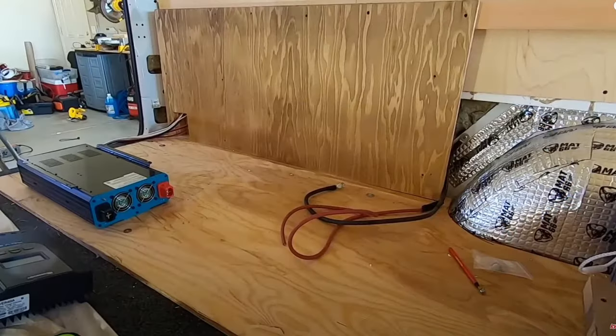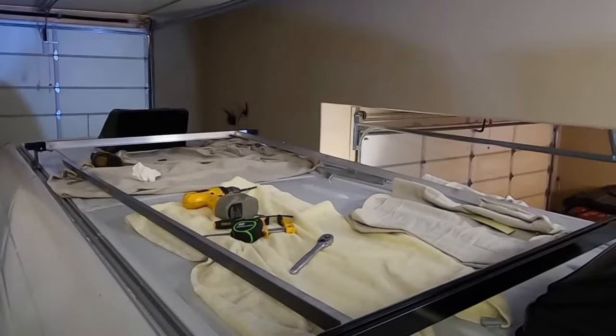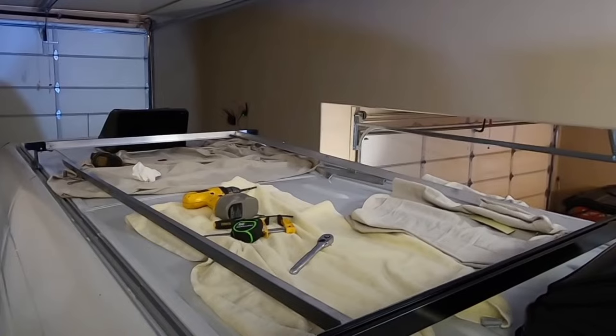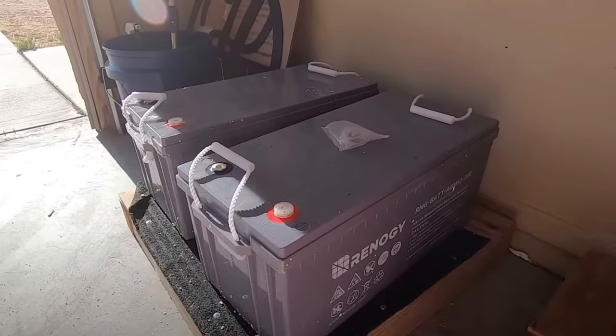Here's another look. I also installed the solar panels up top — I hand built the frame on top of the van. This is a 2019 Mercedes Sprinter. I sized the rack so it can fit exactly four Renogy panels, 400 watts. That's what it looked like when it was done — four years, and they're still producing power. One thing I did get rid of was the AGM batteries; I upgraded to lithium, which is a different brand, but probably going to be switching back to Renogy.